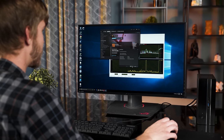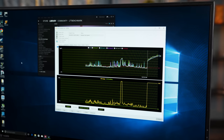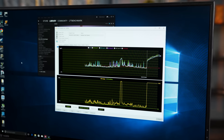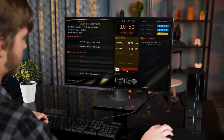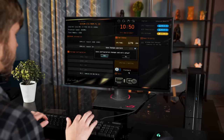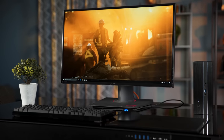Even after that change, our cooling woes weren't quite over. With the fan curve set to its default silent profile, the CPU was getting up to a toasty 75 degrees just doing basic things like installing programs. A quick trip back to the BIOS did fix this, but it introduced another problem — since aftermarket cooler options are limited, we're stuck with a system that's annoyingly loud, especially while gaming when the GPU fan joins the chorus.